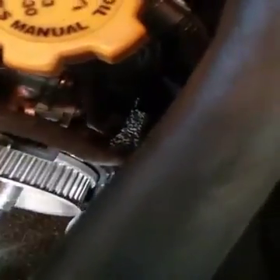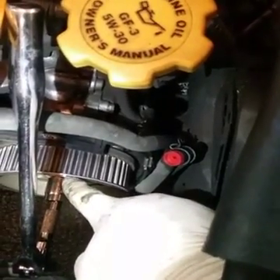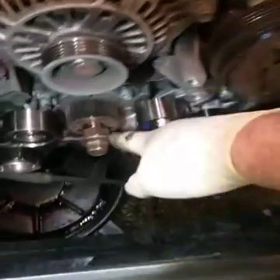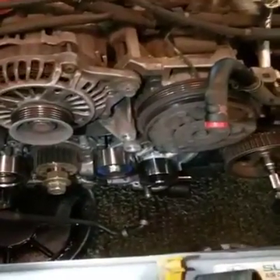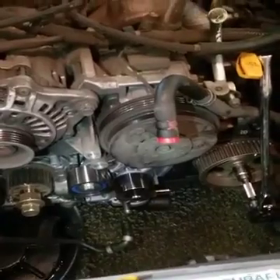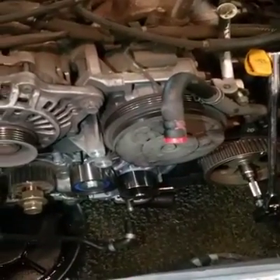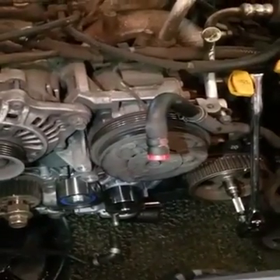Right here is a cam sensor — you see it just protruding there, that little round disc. That senses the position of the cam. Now with this being off a tooth in relation to the crankshaft gear, when those two get out of alignment it throws the cam sensor off and the engine starts running all kinds of crazy. It puts a code for a bad cam sensor, when it was not the cam sensor — it was the mechanical timing that threw the signal off for that cam sensor. But the computer doesn't know that; the computer always assumes mechanical is fine.